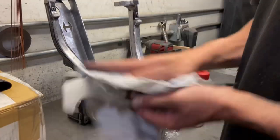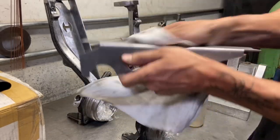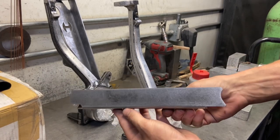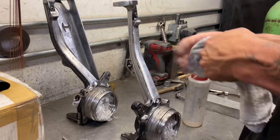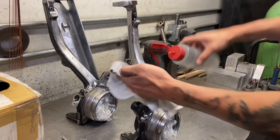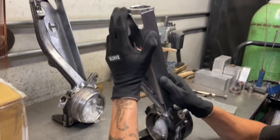I'm gonna clean them off with a little acetone. You can see how shiny they are - you don't have any of that black scale on. Especially if you're gonna be TIG welding, you don't want to be trying to weld through that because most of the time you'll get undercut or it'll pop up and ruin your tungsten. So just more acetone prep - go ahead and clean everything really nicely.